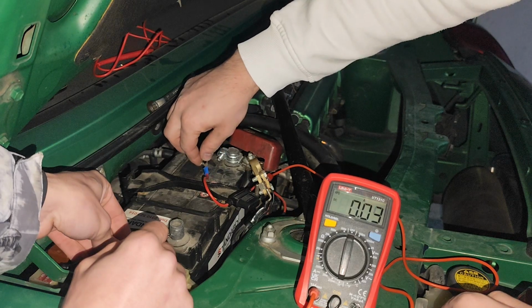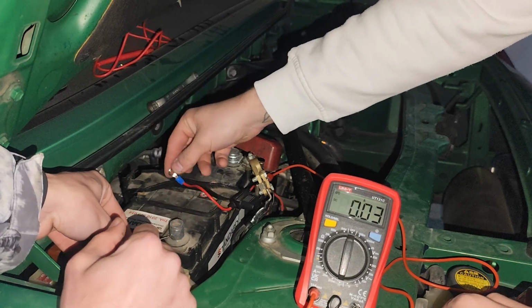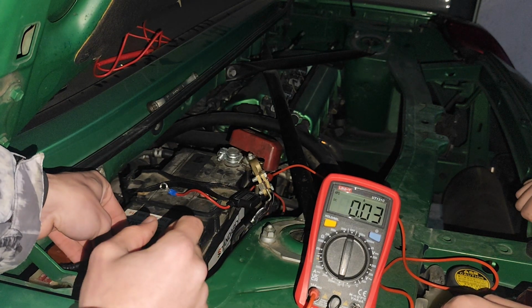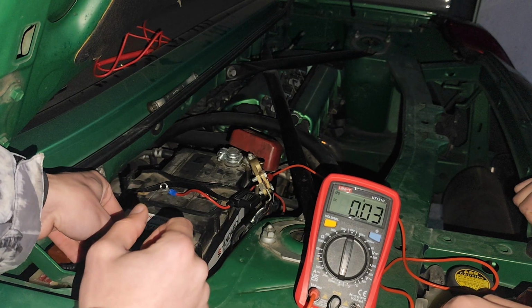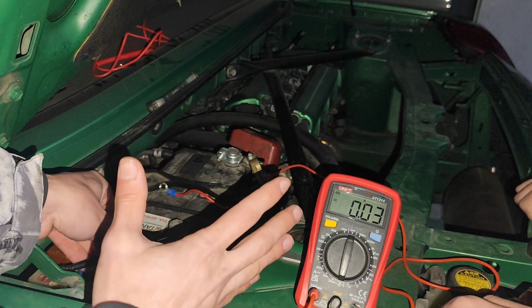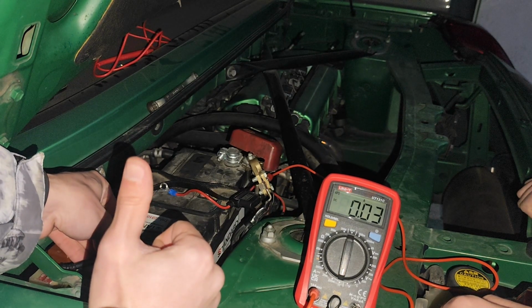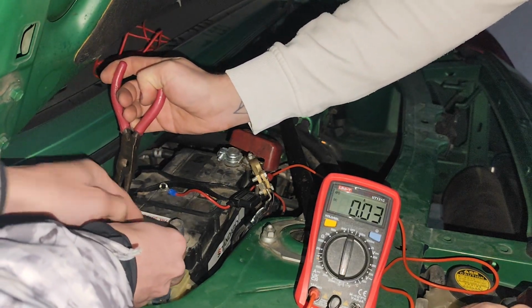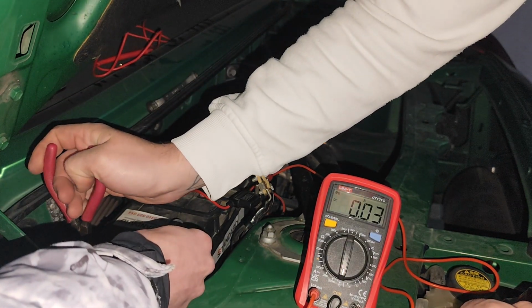Remove it. Alright, so yeah, we will definitely remove that. We will wire it to the ignition on, because it's pulling almost 10 milliamps, and that is crazy. That changes already. It gives us almost 2 days for our little battery to survive. We'll be doing a stupid thing now. So, okay.